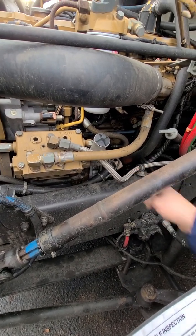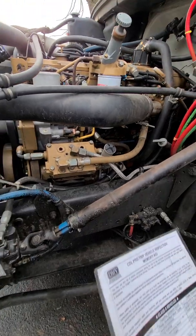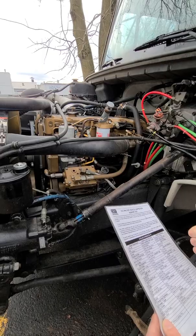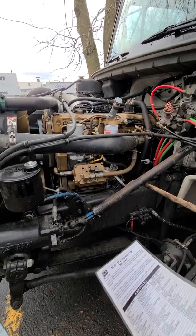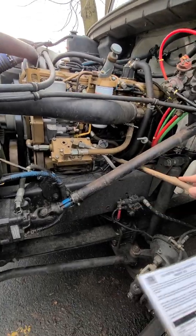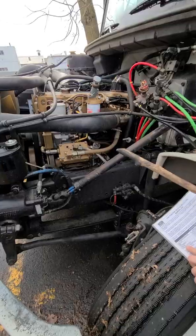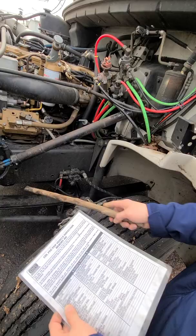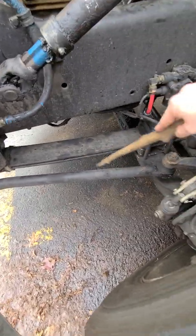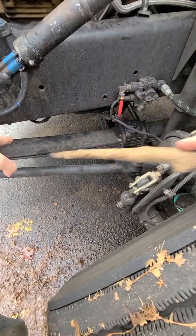Power steering pump, securely mounted, no crack, no damage, no leaks, no missing or loose nuts, bolts, or parts. Good condition and works properly, and also gear driven. Make sure you say gear driven. So air compressor and power steering pump are gear driven. And hoses. So I go back to fluid leaks and hoses. Also on this side, no cracks, no damage, no drips, no leaks.